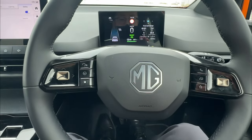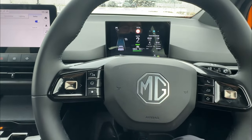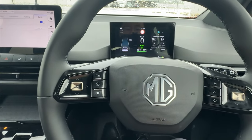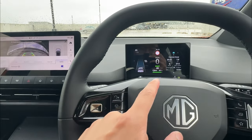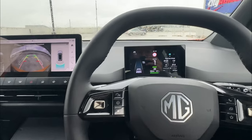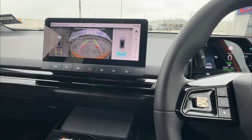For example, pressing the brake again disengages the auto hold — so that's two ways to disengage it. Also, if you put the vehicle in reverse even while auto hold is engaged, it's not going to use auto hold to hold your brake when reversing.